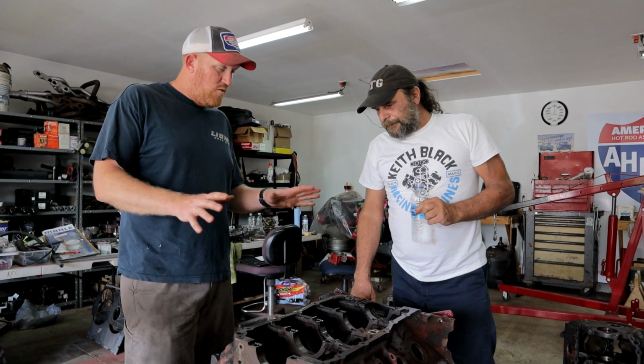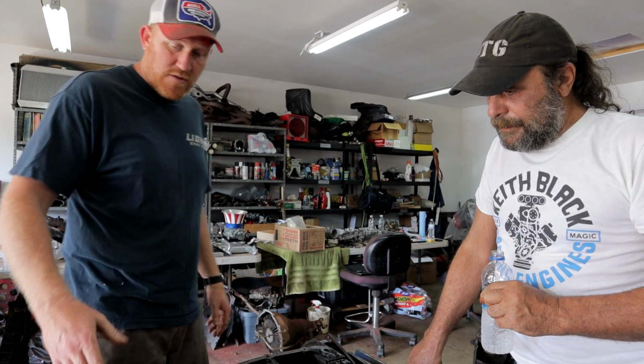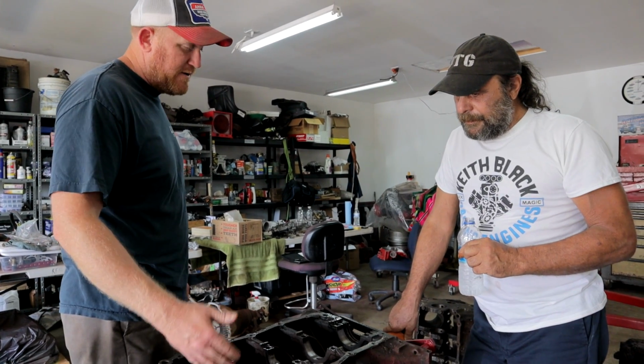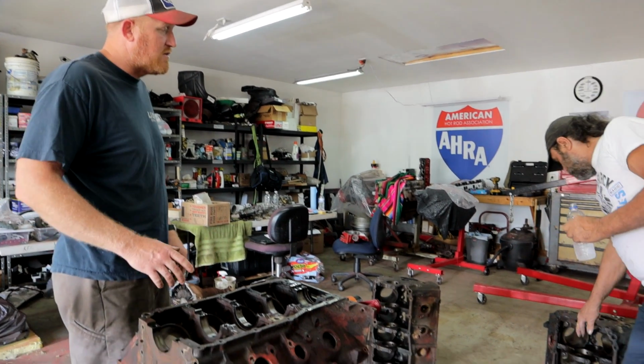Okay. Now, I do know a lot of it is when you tear up a Buick, most of it is main oiling issues, and the mains lead to the rods getting chewed up because they oil the rod, right? But the big one is the volume of oil that you can flow through the motor, the better it's going to be. It has a big main journal. That's where they made up the strength in the motor, with the diameter of the crank main journal.